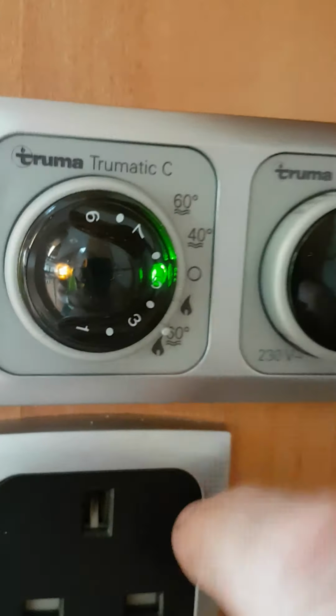So once you drop your red valve and with the fan off and your pump not running, you'd open all your taps in between hot and cold and actually blow into these here, and that's pushing all the water out of the van, and empty your 2 tanks, and that's the van empty.